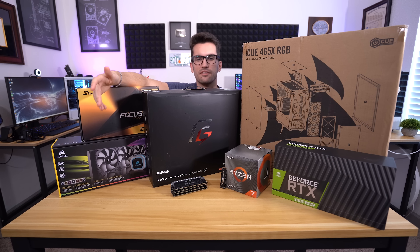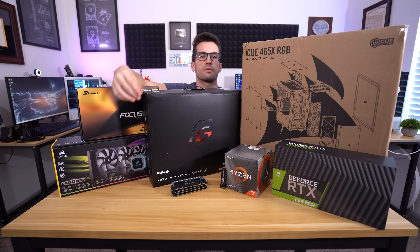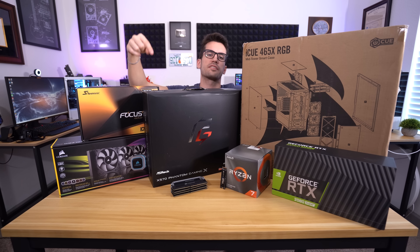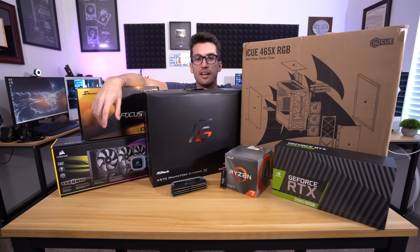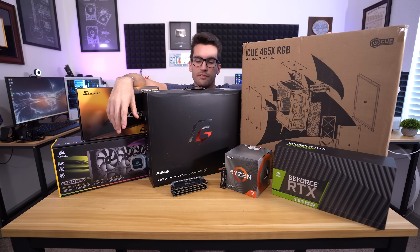I don't recommend Ryzen 9. We could have used that, and that would have been potentially an overkill gaming system. You're not going to see a huge difference, if any difference at all, between 8 cores and 12 cores for most if not all games. So if you're going to go for just a purely killer gaming system, Ryzen 7 Zen 2 is the sweet spot right now. You could go with the 9900K or the 9700K from Intel, but Ryzen right now packs the value for the money. Am I going to buy a $300 processor or a $450 processor if they're pretty much neck and neck in a lot of games? That's why I went with the Ryzen 7 chip.